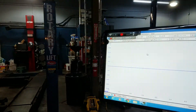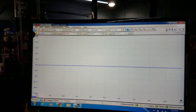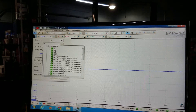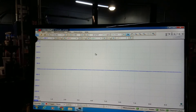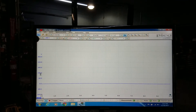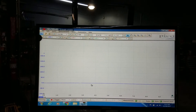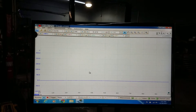We'll go ahead and show you again where to choose that setting. If you right click, you'll see we have all channels but A off because we're only going to get the primary ignition on channel A today. Right here under probe, in the built-in choices you have times 1, times 10, times 20. We're going to choose times 20 because we're using the 20 to 1 attenuator. I like to use plus or minus 400 because primary ignition exceeds the lower settings more often than not. Then I'll take the voltage scale and run it down to about two lines above the bottom, so you can see something that might take place below the bottom but also see the primary waveform above zero.